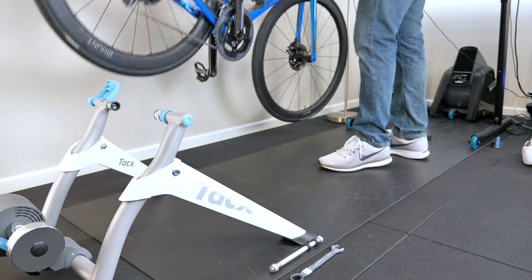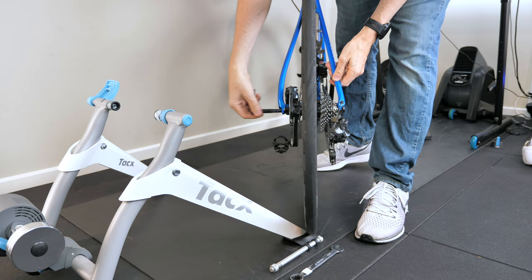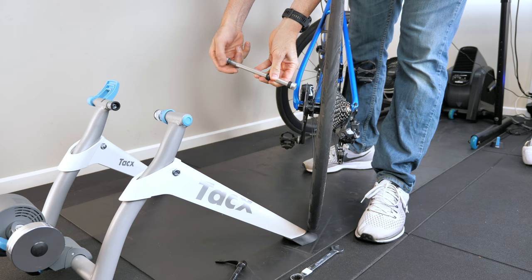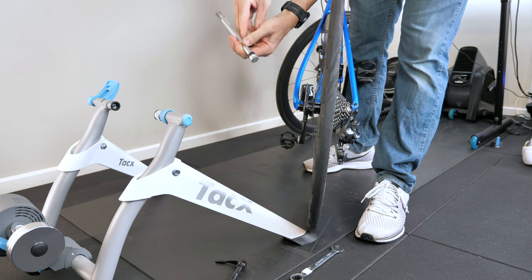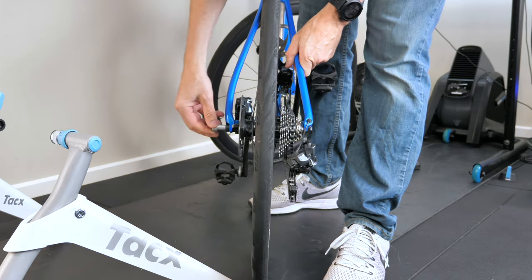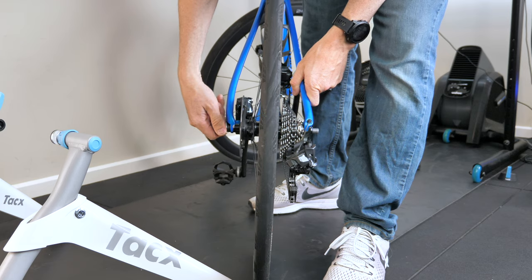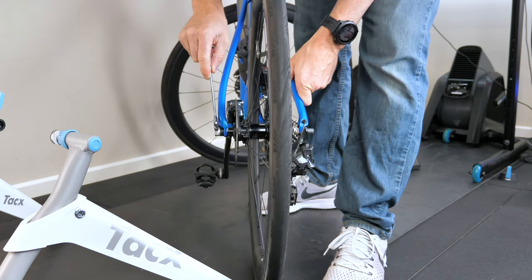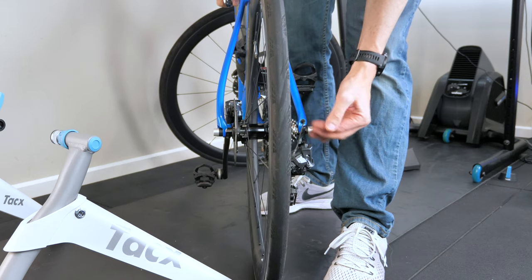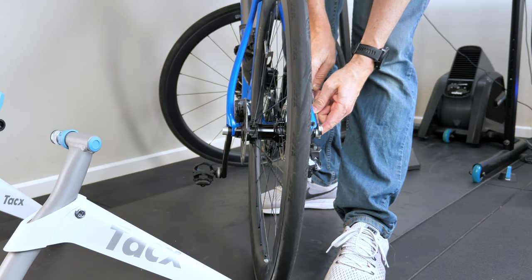On to the installation — this is very straightforward. My Giant TCR bike here has a 142 by 12 by 1.5 thru-axle. Remove the wheel's thru-axle, grab the adapter, remove the end nut, and then use just one spacer on the non-drive side — the larger spacer — to get the correct wheel alignment. Screw that in; it's a slightly longer thread than a normal thru-axle so it sticks through. Snug that down with a 15mm wrench, just as tight as you would a normal thru-axle, then add a nut on the drive side and snug that down with a 15mm wrench as well — just a little bit, not too tight.